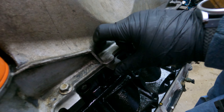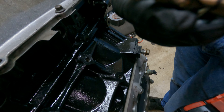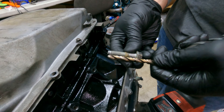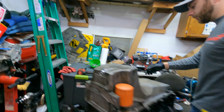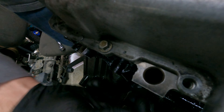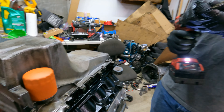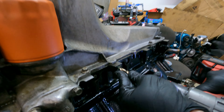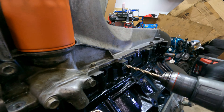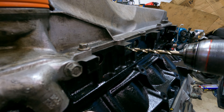The bolts are an inch and a half in, and we could plug the sensor, so it might be enough. The other side doesn't really matter because it goes through to a hole there. Hopefully the bolt won't be too short or too long, but we can cut it down if we have to. This is an iron block, so it should be pretty easy to drill. We also covered up the exhaust ports just in case we get any shavings in the engine.